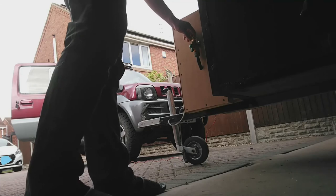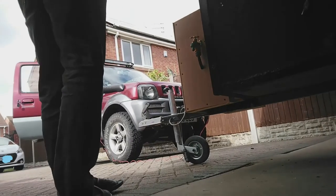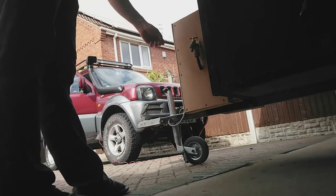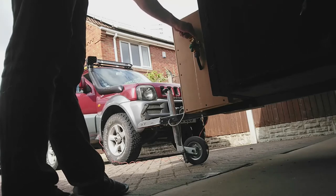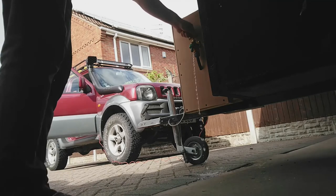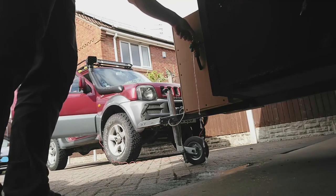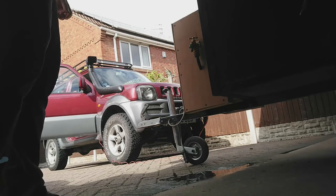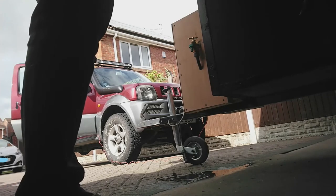I'm not entirely sure that's picking up any water. Problem turns out to be the filter on the end of the pipe floats, which isn't a lot of use, so we need to find some way of securing that to the bottom. Now we have water. And the pump seems to settle down, still clicking.